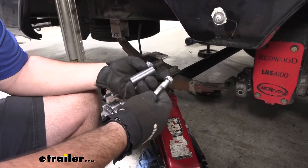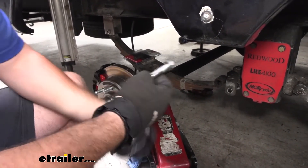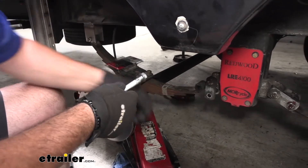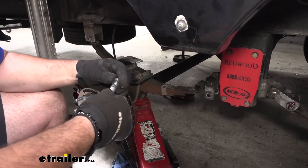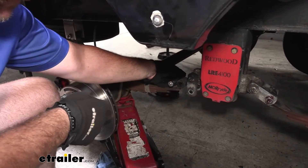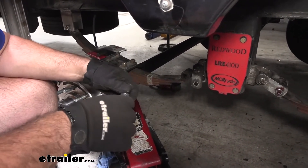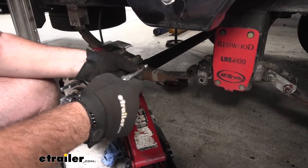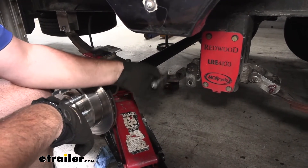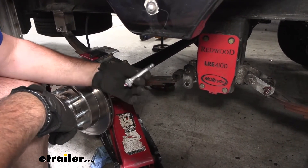You're going to need an 11/16ths and a 13/16ths socket. 11/16ths is for the nut side; 13/16ths is for the bolt head side. You may not need the 13/16ths right off the bat because the teeth grab into the plate. When you get the nut loose, loosen it all the way, then take a hammer and hit it on the back side to knock those teeth loose. Take the nut off and push the bolt out the rest of the way. You can sometimes spin and pull it out with the jack adjusted just right. If you can't, take a Phillips screwdriver, put it on the end, and tap it lightly until the bolt pops out.